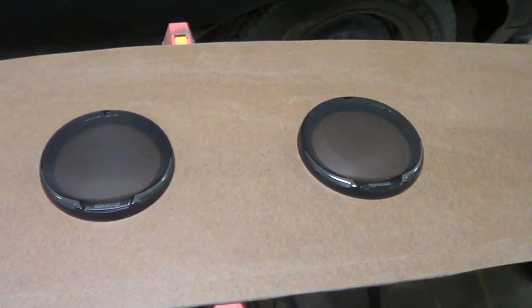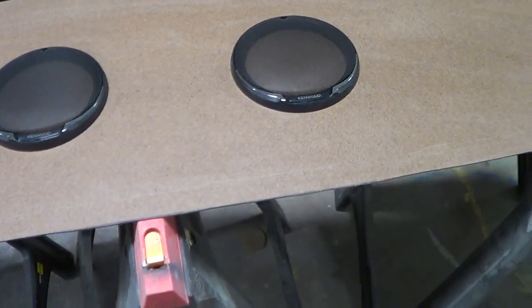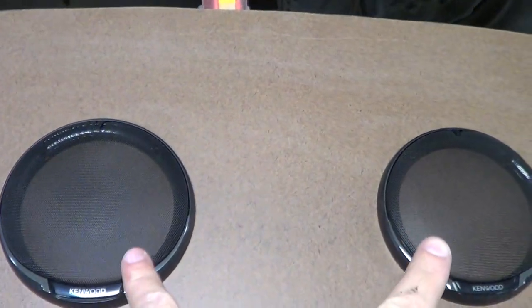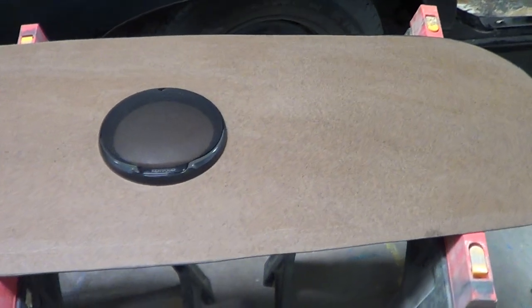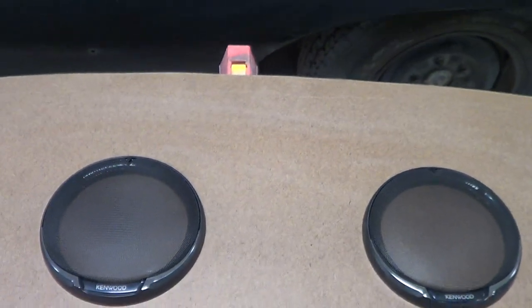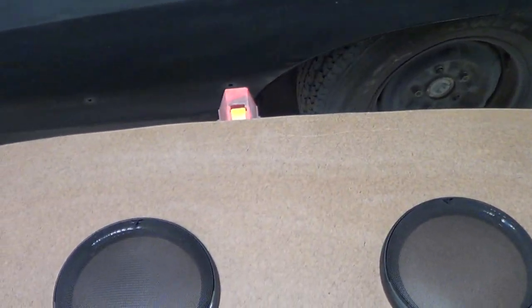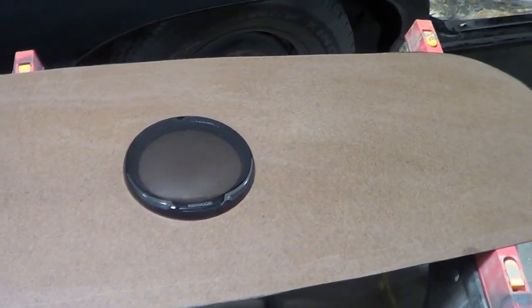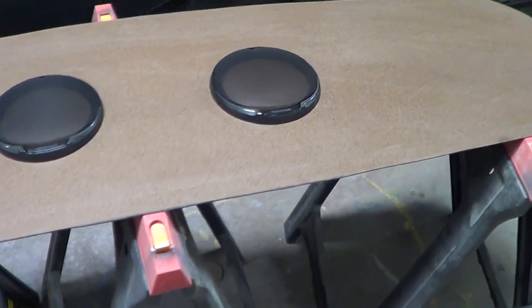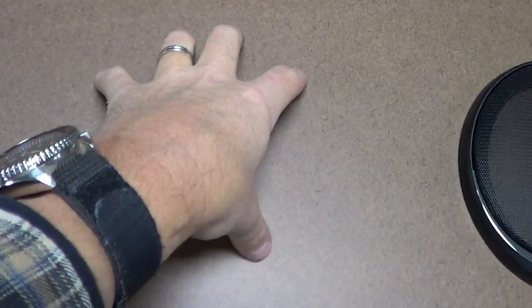I think I've sent some of these out to some of my buddies — I can't remember how many, but there's been a few. People ask if I can cut it out. What I do is you get this board with the initials in it, and that's just how I send it out. I let you guys do your speakers because this thing will move a little bit back this way or that way, and you want to make sure you get everything centered. It really needs to be done while it's in the car to make sure everything is a proper fit. That's why I do not send these out with speaker holes cut — because in some cases you're not doing a Hero car and you want your speakers more over here in the stock location.